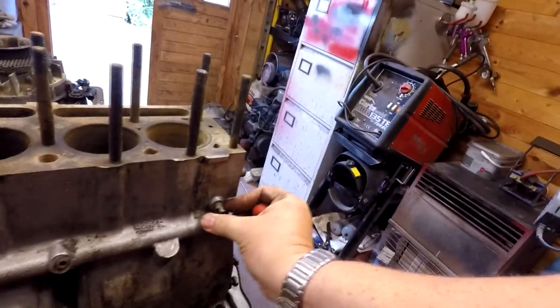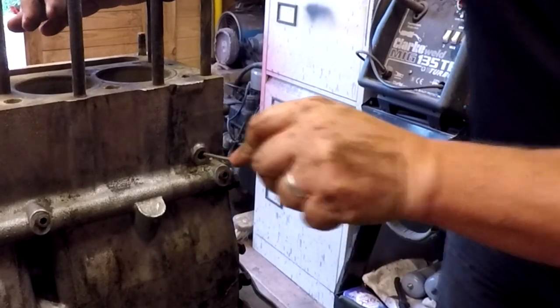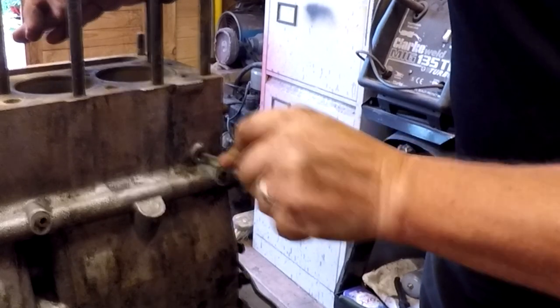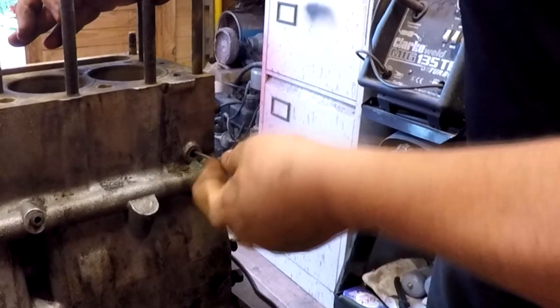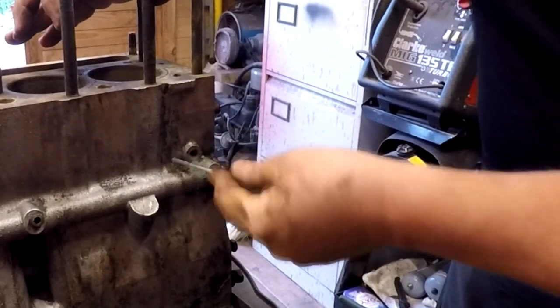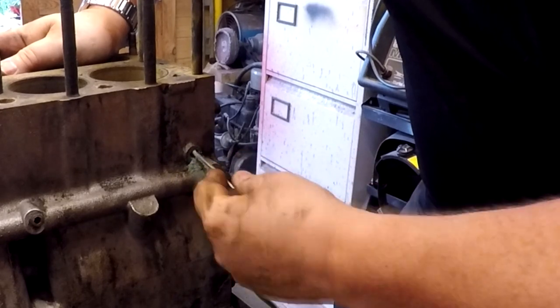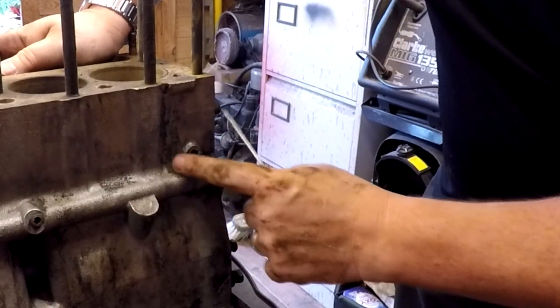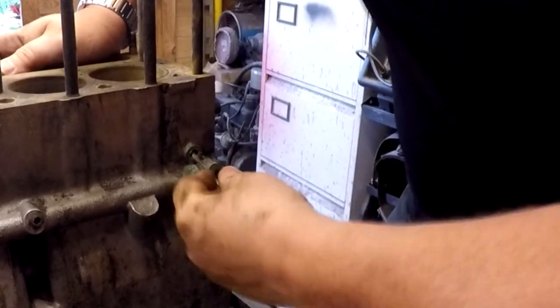I think I've also found a bolt down here — I've taken it out, it was really tight, so there's obviously a lot of corrosion there. I believe that may be a drain bolt for the block to drain the water out. By sticking a screwdriver in there, it's actually solid with what I think is corrosion. If I have a dig about in there, this as far as I can see is pure corrosion coming out — and that should be free-flowing. I'm having to chisel into corrosion that's built up over years and years.